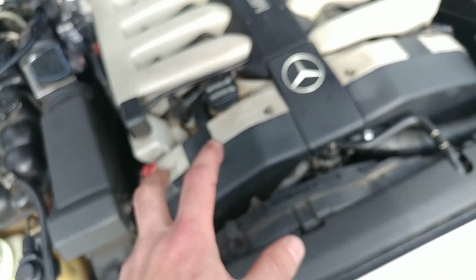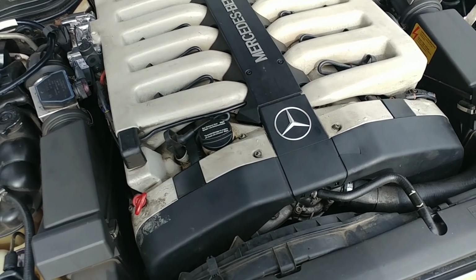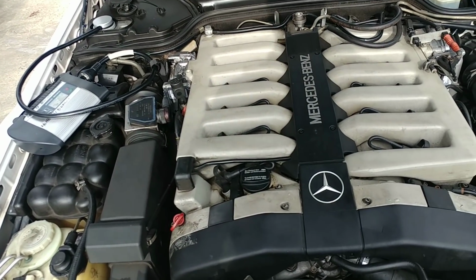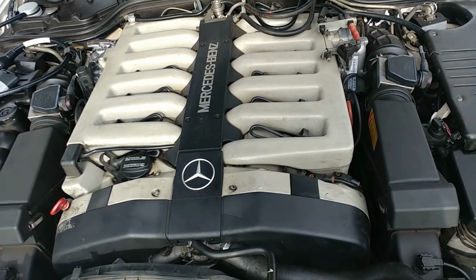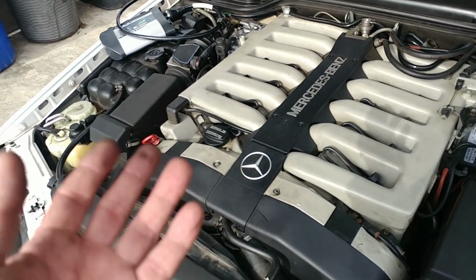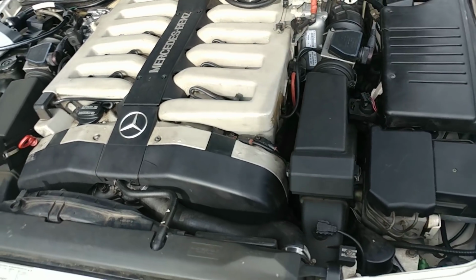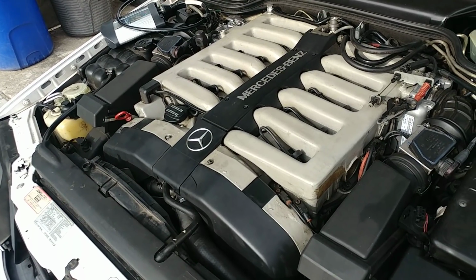Suspension, I'm going to show you a little bit later, because I replaced all 4 accumulators. Only one was halfway dead. The other 3 were totally blown, and they were already replaced at some point, but maybe because the car never drove a lot, they probably just blew because they have to work, they have to move. So totally blown. Suspension is really good now. I drove the car a little bit and it feels very nice. The accumulators level is refilled for the suspension.